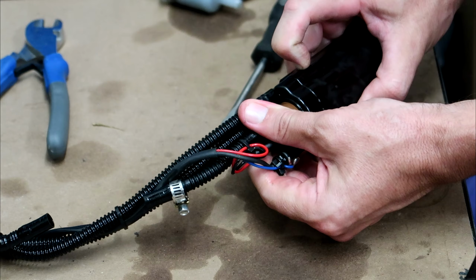Then you've got your 3 8mm bolts to remove the actual tank itself. So you've got the one on the top there, and then you've got one on each side and the front of the radiators there. When you pop these out, you may find a washer goes flying out like just happened to me, so make sure you collect that off the floor so you can put it back when you're finished, and then just remove the tank. It's as simple as that. Then don't do what I do, use a funnel to pour the fuel into your jerry can.